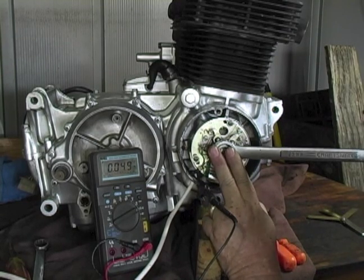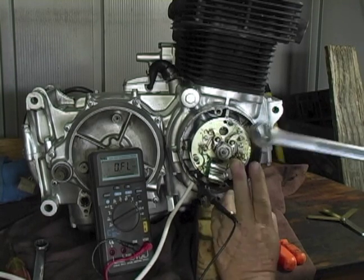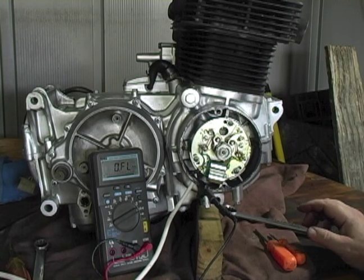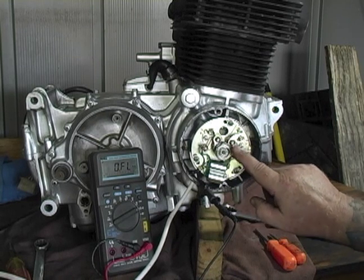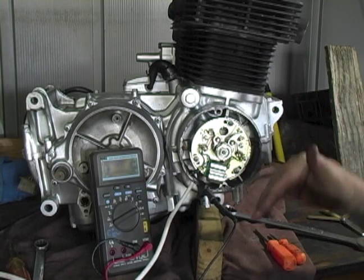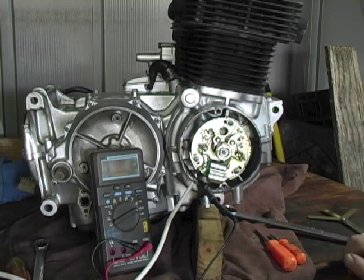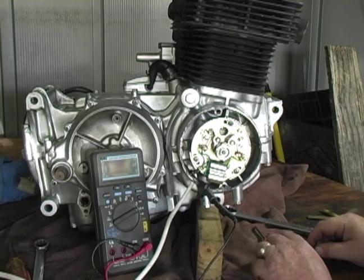Getting close to the F here — we're just going to kind of bounce it. You can see the shift on the grayscale on the bottom, how that's bouncing around. It's coming on a little early, which means as we turn this way, the bump on the cylinder — the mechanical advance cylinder — is getting here too soon. Which means we have to turn this part away for that to happen later. It's got its own little plate with two screws holding it in place and a slot to adjust it here. So let's break those loose.